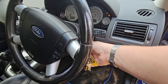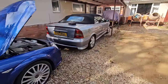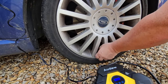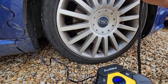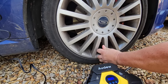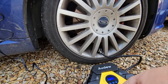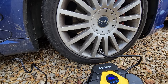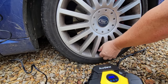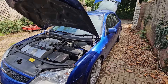I'm just going to start the car up and come around to the front. Just make sure it's set on PSI, which it is. We've got 27 PSI in there, so I'm going to pump it up to 34 PSI. I'll go around the rest of the wheels and do the same to them. Done — gone around all the tyres now. There was only a couple of pounds low here and there, so I'm happy with that.